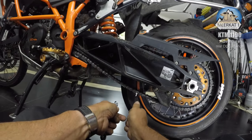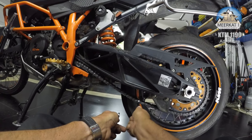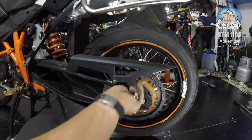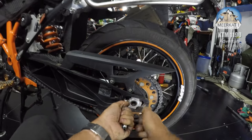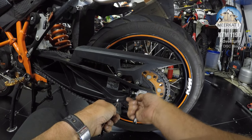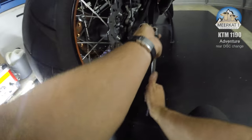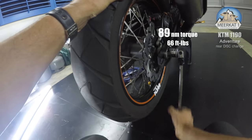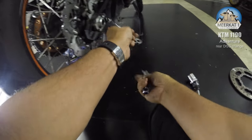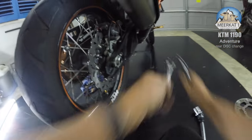I'm looking for 40 to 45 millimetres of play on the chain, so I'm just going to set my chain tension. Crack it with a 13 and tighten it up with a 10. Final checks are that the main nut is tight, and I've used the 10s and the 13s to reset the tension, then a 13 to lock it off.